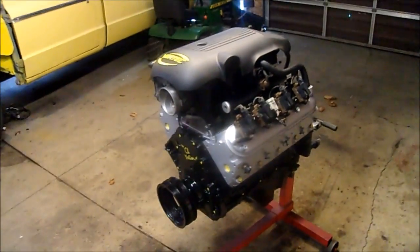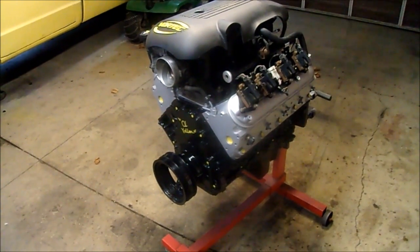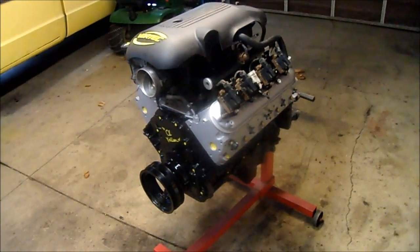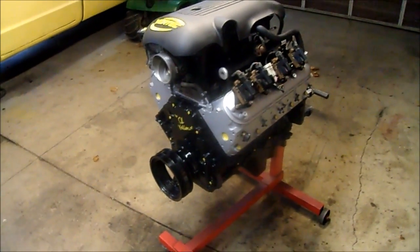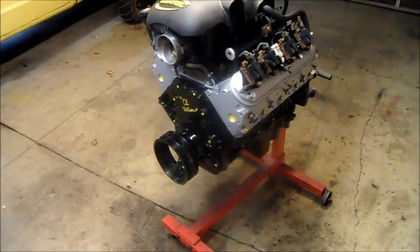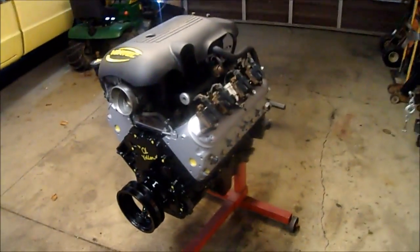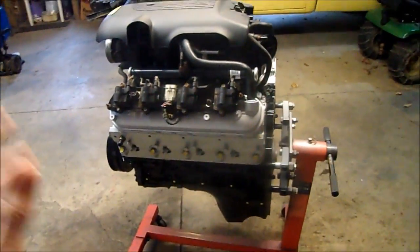And then I know some guy locally who will program my computer for $100, which is a good price, and he will program the computer to run the 4-speed. That'll give the drive-by-wire a nice quick throttle response, because the auto program has a little bit of a delay. And then of course we'll get rid of the VATS and the emissions program, and then that'll be all set. So next up, guys, next video, part 5, will be engine mounts.